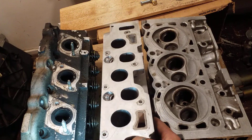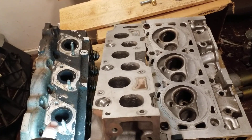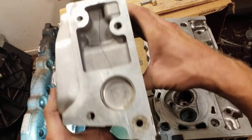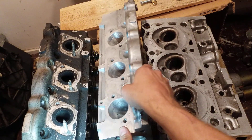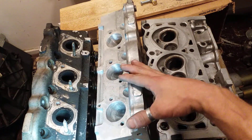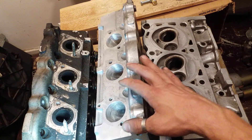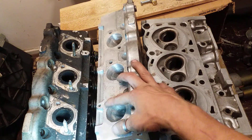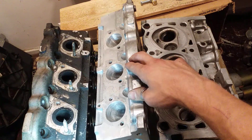With the intake manifold side, there is a good amount of volume because we have split port. You're going to recognize that we have that much exhaust flow but this much inflow — that's almost double. So when you come to look at the port job now, you understand why. It's actually giving the intake airflow the ability to hit the exhaust in the same amount of port flow with a nice camshaft. So if you put a really nice camshaft with good lift and duration on there, without even having to port the intake side — other than down the valley — and then a nice exhaust port job, you can make a substantial amount more power off the same modifications you've already done.